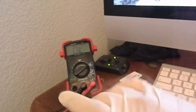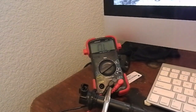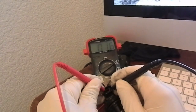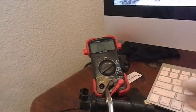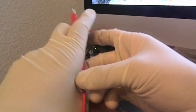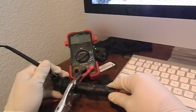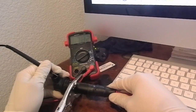The one I've been suspecting is coil 3, which is this one. I'm using a plier just to hold it in place. Once again we're going to do our primary resistance test — we're within specs there. Alright, so now we'll do our secondary resistance test.